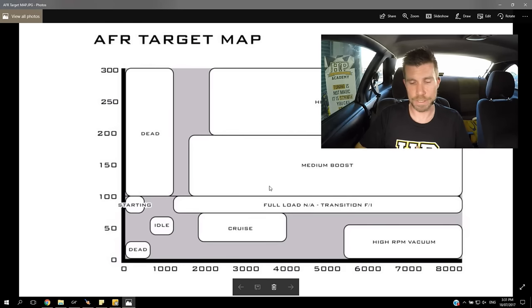Let's move back to my laptop screen and address this air fuel ratio target map again. Really when we are tuning — regardless whether it's naturally aspirated or turbocharged — what we're wanting to do is use the dyno in the smartest way possible to replicate the way the engine is going to run on the road. This is where we're breaking up our tuning process between steady state tuning and ramp runs. What we really want to do is steady state tune the fuel and ignition maps in the areas that the engine is actually going to be operating in steady state. For example, at wide open throttle the engine is going to be accelerating, not in steady state. However, if we're at perhaps 15 to 20% throttle in a high gear under cruise conditions, the RPM stays relatively consistent — that's steady state, and that's how we're using the dyno.